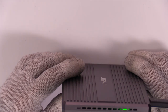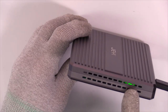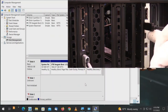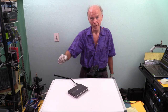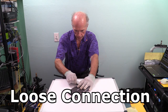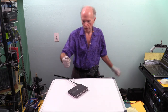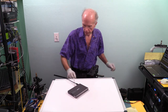We can see there are some green LEDs inside — this is apparently to let it breathe for the PCB. There's an LED toward the back only seen from here, and another LED you can barely see through here that lights everything up. I haven't messed with this connection, but I did fiddle with the connection on the Thunderbolt card. I'm wondering if maybe we have a problem with the Thunderbolt cable — it's brand new, came with the device. I'll unplug from both ends, swap, plug the device first then plug into the card. We may have to try a different cable.